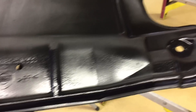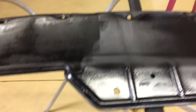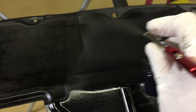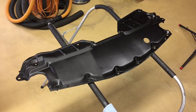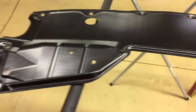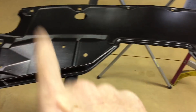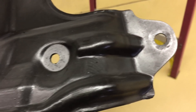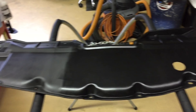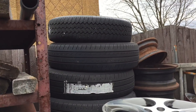No texture whatsoever from being in contact with a roller or application tool — looks good, gets in all the corners and tough-to-reach areas, lays down nice. Compared to a regular spray gun, the airbrush system goes on thin, so I'm going to put on two or three coats depending on how bad the plastic trim is. One coat from the airbrush, one coat from the roller, one satin and one gloss side. If you want a darker, glossier look, put another coat of gloss. If you want a nice deep rich look from the satin, put another coat. I'll let that cure the rest of the day or overnight, and I myself will coat and protect it before sending it out.